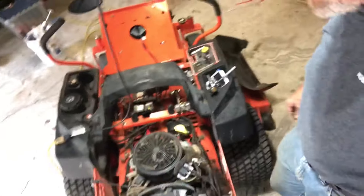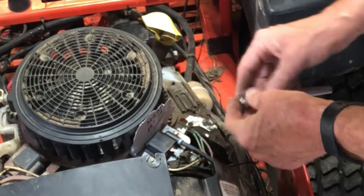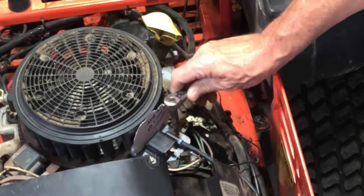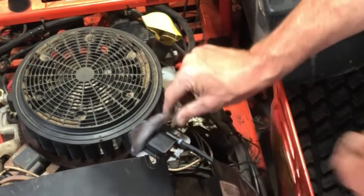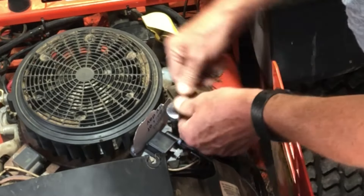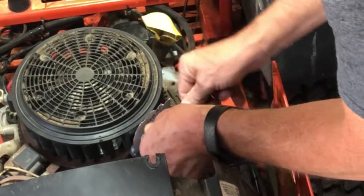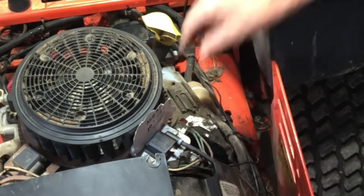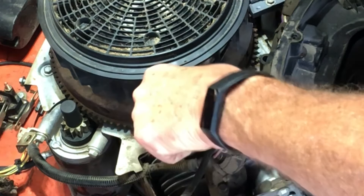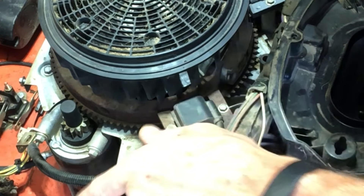We'll go ahead and reinstall the ignition coil - I used a piece of cardstock as a gap. Actually, let me check that gap on the old one that I haven't moved yet. Just tighten it down - be sure not to strip the two bolts - then remove the cardstock. Now, this is a kill wire, probably hooked up to the kill switches. So if I hook this here and I get spark, then it's a kill switch.